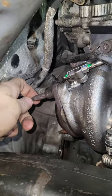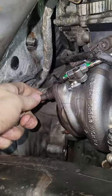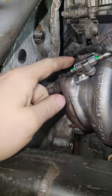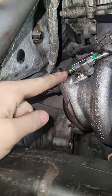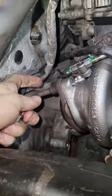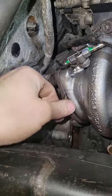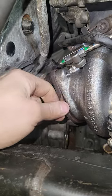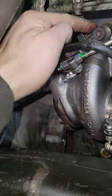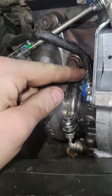So if you've never done one of these, I'd start with the exhaust bolts off. And then you're going to have to — if you get any turbo — it doesn't come with this adapter. So you're going to have to take these studs out anyway, so if they come out when you're taking the exhaust off, it's not a big deal. Just watch this adapter gasket — I reused the gasket. It's not a crushed sleeve gasket or anything. You're going to need this gasket for the manifold, and it should come with this.